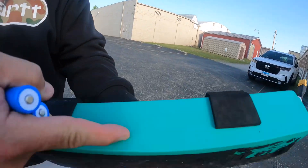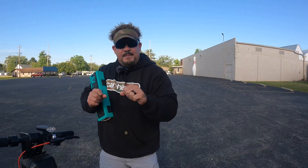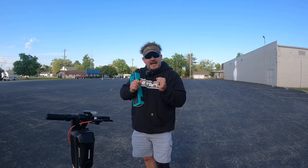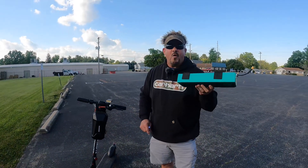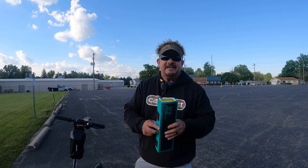When putting it back together — since you've had to cut the casing — duct tape it back tight. As you're riding, the scooter jars around, and if those cells are loose and shaking, you'll break another solder lead and have the same problem again. Most of these scooters are inexpensive and made with cost-cutting in mind. This is actually my third battery — I finally decided to spend 80 dollars more on a quality one, and it's been no problem since.